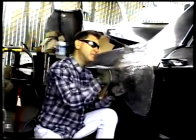We take our body pick and we hit it on top to bring out the character line. This is direct damage, this is indirect damage. Once this pushes in, that sandwiches in. So we're going to hit it here, and the pressure we're pushing down on the metal will push the dent back out and give us our character line back.